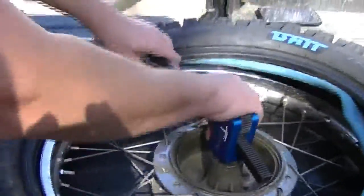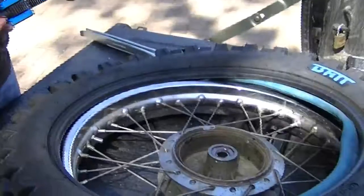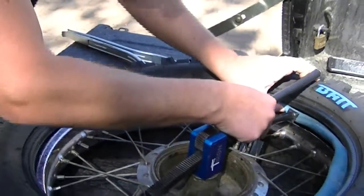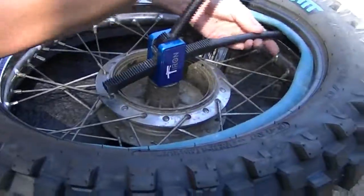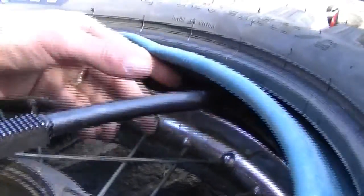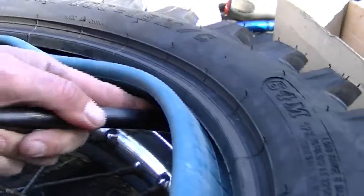Let's give it a bash. So what we're going to do is — we don't want to pinch the tube — set the tire in at the correct length, under the tube. This tool is designed to pick up the bead, working in small bites I'm told. Works pretty simple. As you can see we're not touching the tube — as I work around I grab the bead in small bites and this tool effortlessly pushes it over the rim.